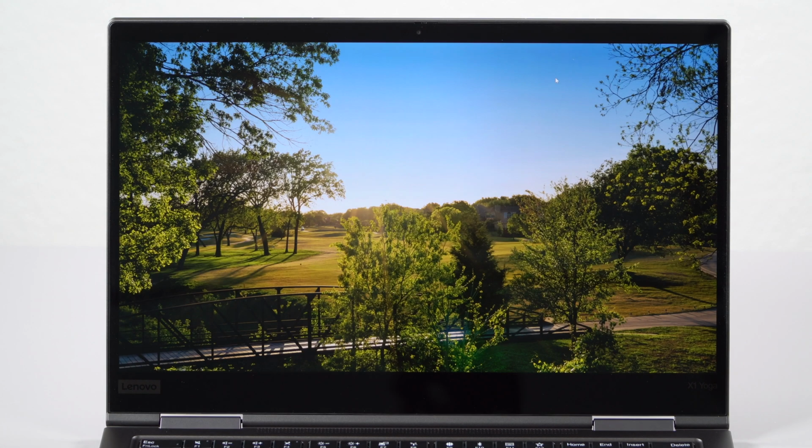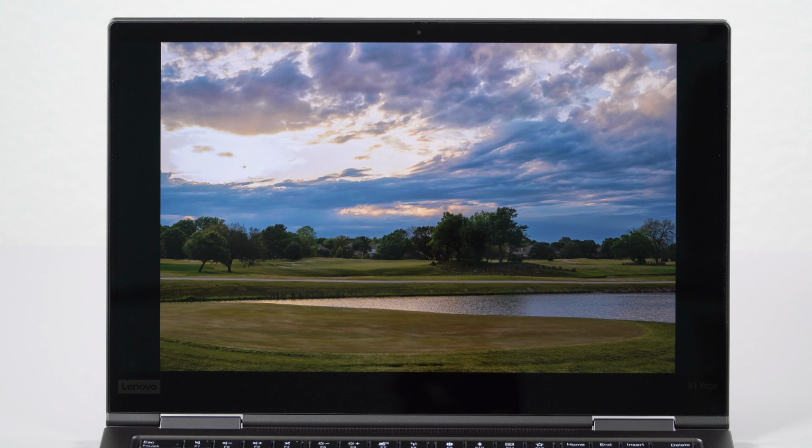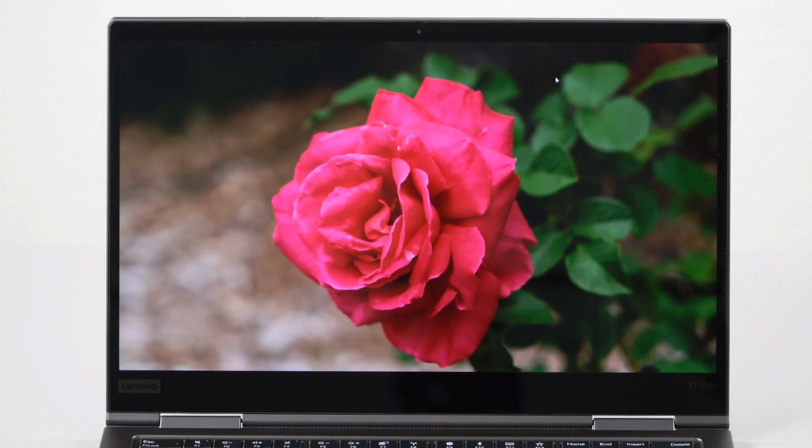You get the idea. So there's also a privacy screen option in Full HD resolution. There is a WQHD display, but it's not the HDR display from the last generation. Well, it's a nice 2K display, and that one is not super duper bright though. 280 nits claimed. And lastly, there's our 4K display. Now, Lenovo claims the 4K display is 470 nits. We only measured 400.